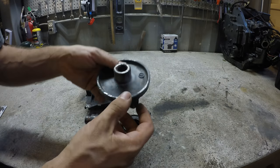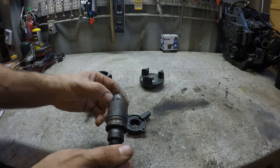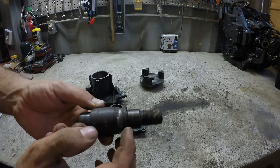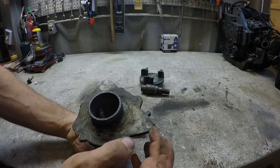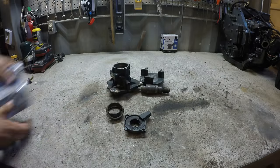These are available. You could maybe even straighten that out and run it. The other thing I did could be filled. That's savable. But really, I need a bearing puller to pull this inner race off of this shaft. Plus this housing, all these ears are cracked. I didn't do that. It was like that, but you could probably still run this thing. Here's the bearings for it.